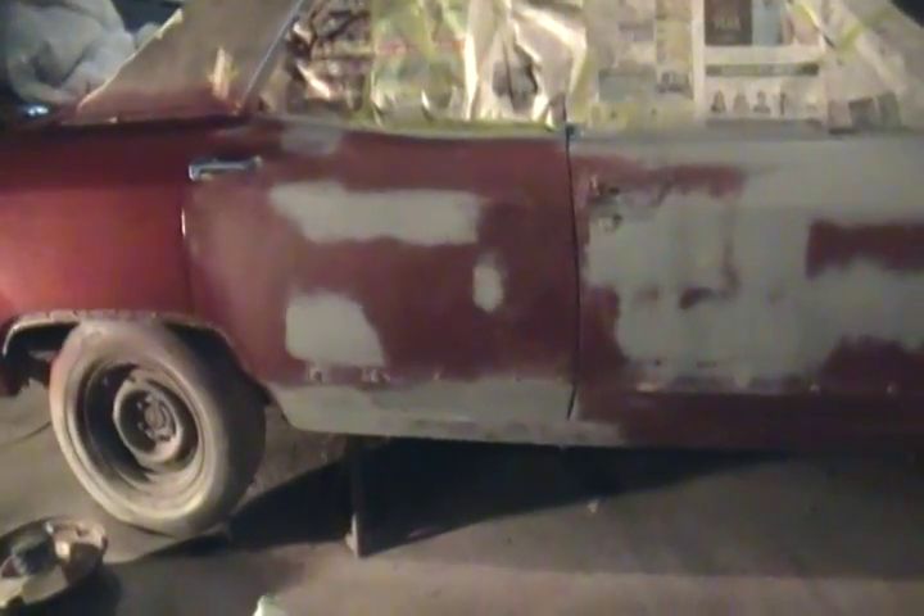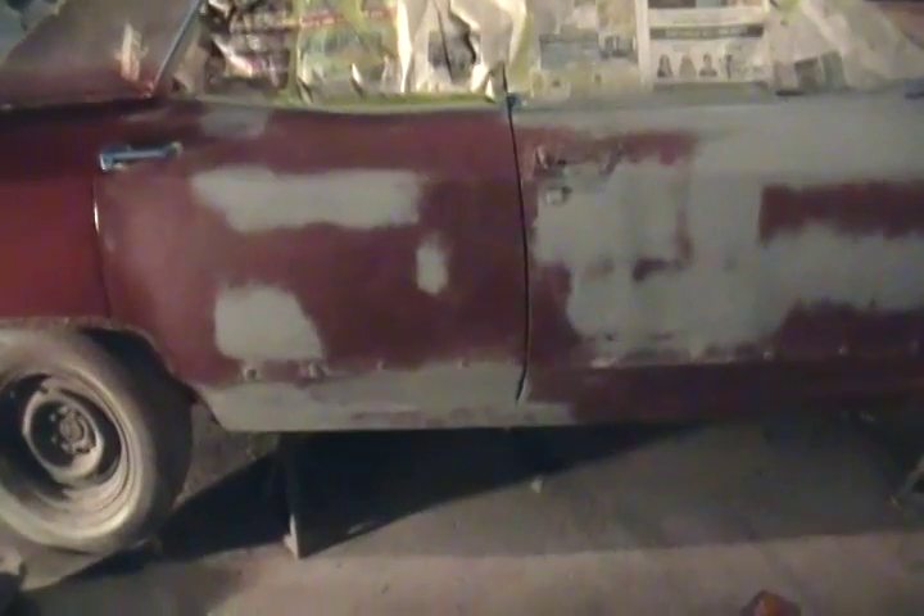There never was anything wrong with it mechanically. But all these areas have been hand sanded. The guide coat with red, which is the color — I've got it covered up here. The shiny areas from the original guide coat I have to go over by hand with some 400 wet sanding paper.